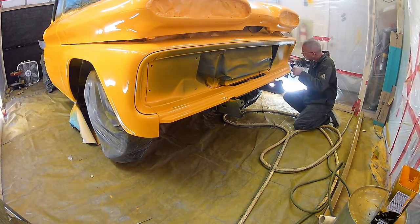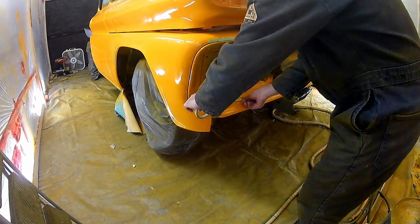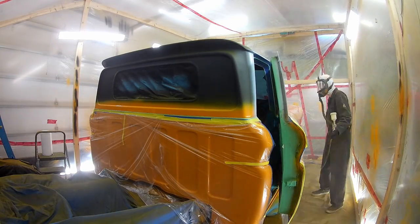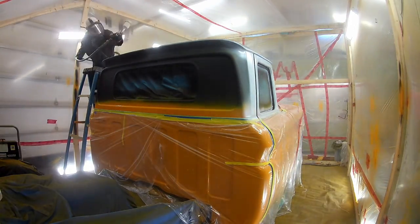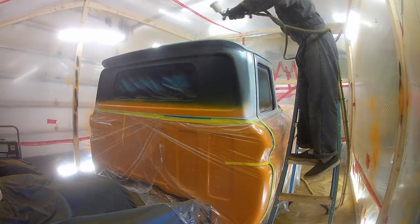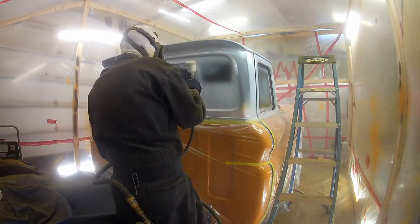So I'm using an eighth inch 3M tape to mask off the outside. I did put a bit of seam sealer in the fender corners to make it a bit tidier — one of my pet peeves. Fatten her up with a little bit more tape. We're going to mask the whole thing and spray down some white. In this case I think I used a touch-up gun, because I'm doing the part of the door jamb. I did like three coats inside the doors and then I'm spraying the outside. And I probably won't mention in the video that I was running out of paint, so I didn't do the top of the truck. I just did the sides of the cab in the front and then picked up another quart of white paint when you weren't looking and then sprayed the whole top with the DeVilbiss gun later on. But masked everything off so you wouldn't even notice. Shh, don't tell anybody.